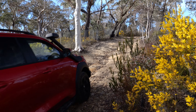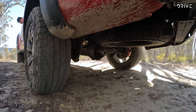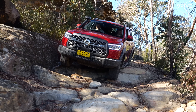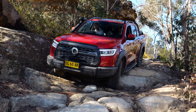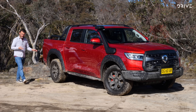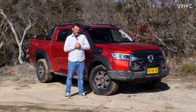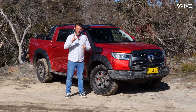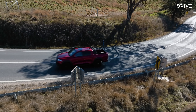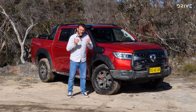Off-road, the addition of improved tires and a locking front differential makes a big difference, taking the Canon from quite impressive to very solid off-road. Full-time four-wheel drives like the Toyota Land Cruiser or Mercedes G-Class need to be triple-locked for a similar result because they have a centre differential. But this part-time four-wheel drive system only needs two diff locks to be fully locked up — meaning zero wheel spin when rock crawling. All four wheels turn at the exact same speed, which is amazing. Locking diffs still feel like you've entered a cheat code off-road. The bash plates do get a workout given the relatively long wheelbase and average ground clearance.